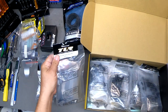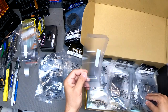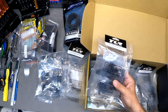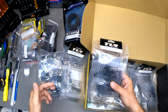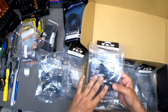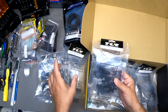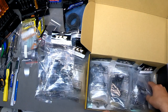They've really gone out of their way to give you every single bonus part for the 22 line of cars in this Elite kit. It's got the little front wing and the big rear wing. The motor plate is a nice black anodized piece with chamfered edges and cooling fins cut into the aluminum on the inner surface. The suspension is incredibly adjustable — we can adjust axle height at the transmission by raising and lowering the differential, adjust it at the hubs, and adjust camber, toe, and roll center by swapping out small items. No need to buy special suspension mounting plates at $30 a pop.